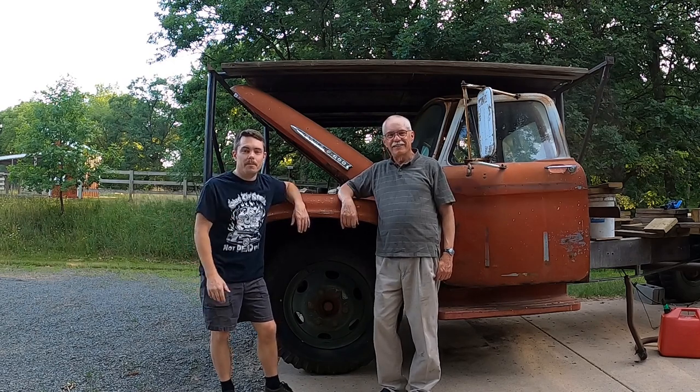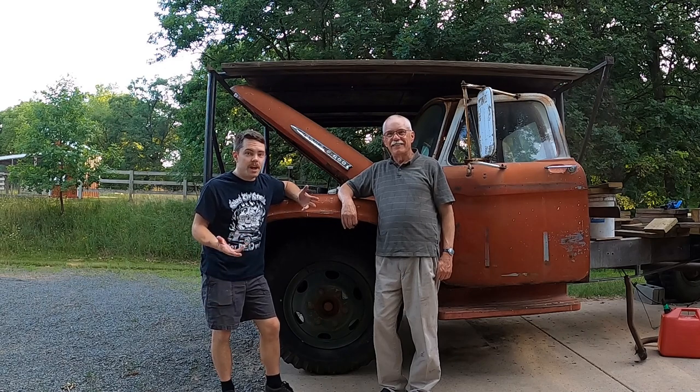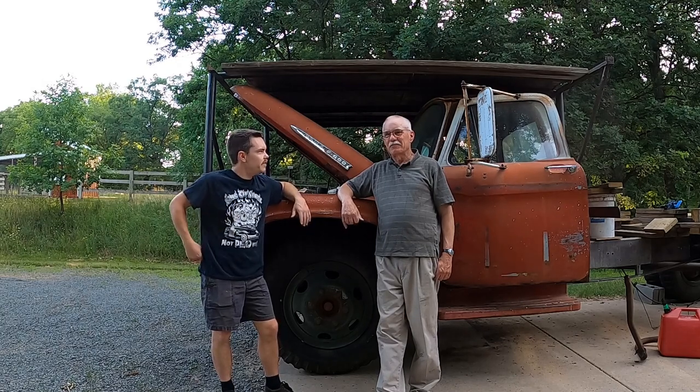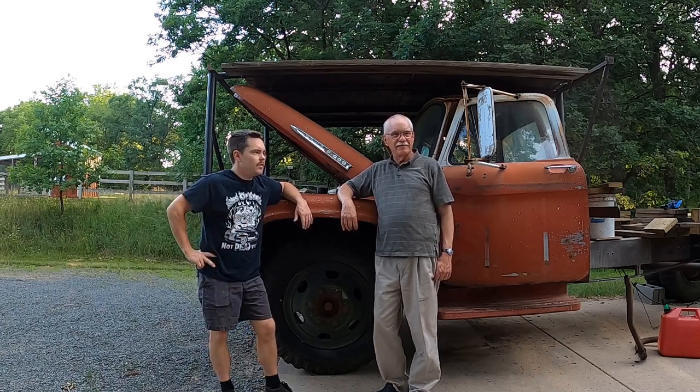Yeah, so if you are not familiar with points, they're really not a problem. You just have to turn the ignition off. But the electricity was flowing through those contacts for like 6 hours. Probably, yeah. So I have some new ones on the way at like 10 bucks. So we'll throw some new ones in. Otherwise, it seems like it runs pretty well.